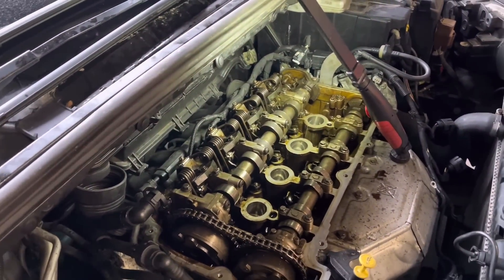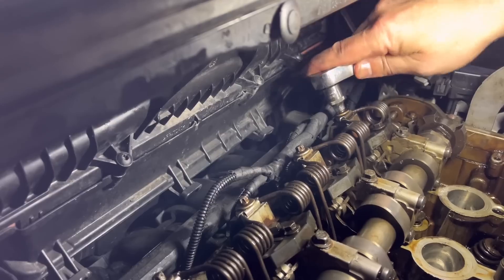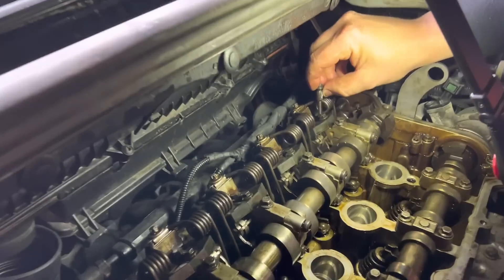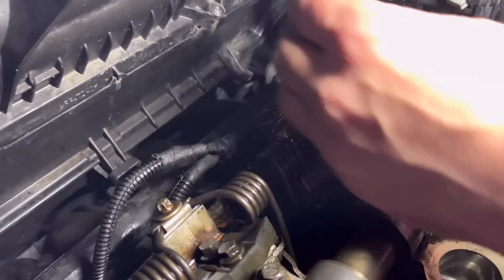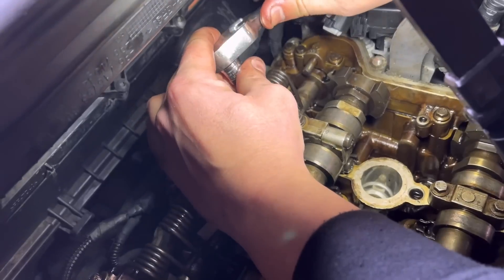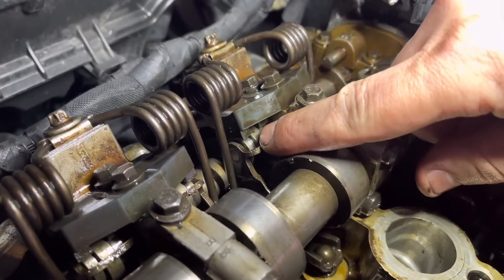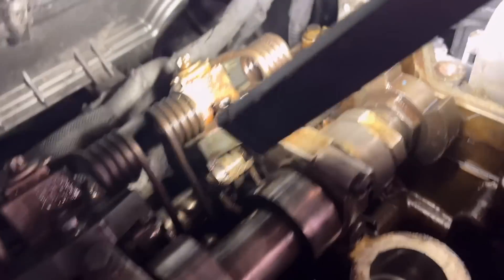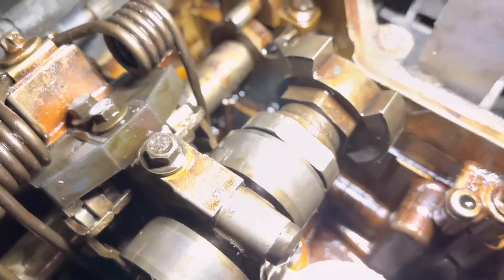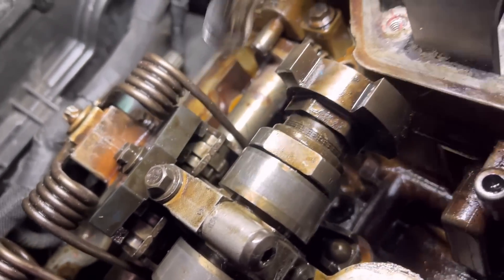Now what I do is just nip the back one up — obviously torquing this up in a minute — and then we put the back bolt in here, that funny-looking bolt, just nip them up there. The final thing obviously before torquing those bolts: make sure that the rollers on the rockers here are in their location underneath that black clamp plate. You can find that sometimes these rollers are either one side or the other — you've got to make sure that they're in. And there we go, all in.